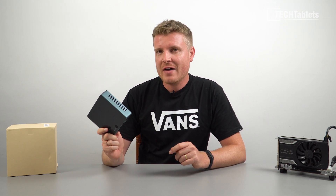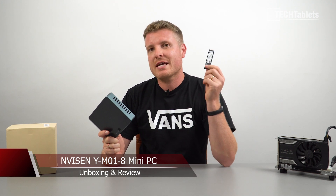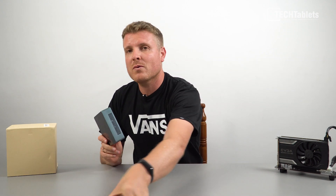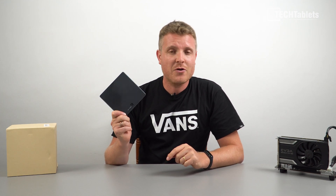Hi everyone, so I'm taking a look at another mini PC. This is a Core i5-8250U one from Banggood that sells as a bare-bones mini PC. So you're going to need an M.2 SSD which can be SATA 3 or PCIe and of course a stick of RAM. Even though it's quite small, it will also take a 2.5 inch hard drive. It turns out it is good.